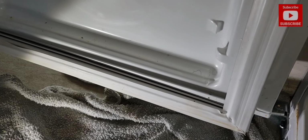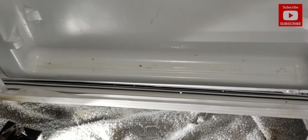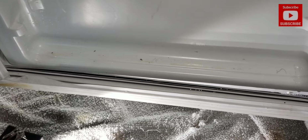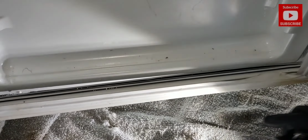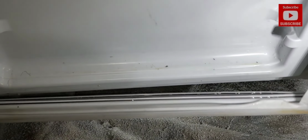The only logical thing that I can think of is environmental. Environmental temperature is getting cold enough where it's creating ice crystals when the door is open and closed often enough. A refrigerator in design is just a heat exchange. As the heat comes in, the compressor is turned on and will remain on for a durational runtime of 22 hours. Within that runtime, the thermostat is what will turn the compressor on and off once temperature's met.